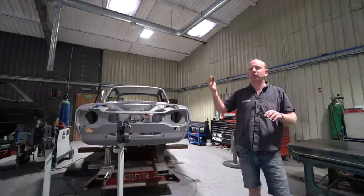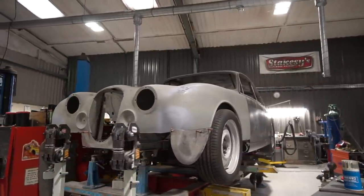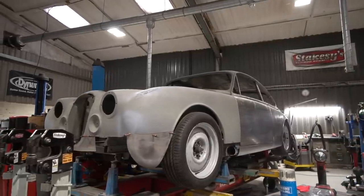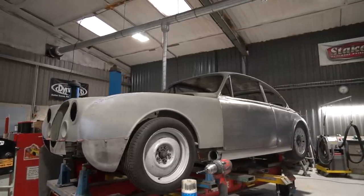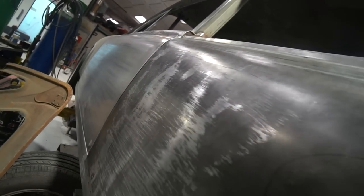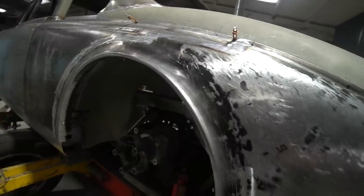When we want to make a panel for a car — say, picking a car that's in our workshop at the moment, we've named the project Churchill, the Mark II Jaguar two-door coupe that we're making — Stu's been making a lot of panels for that. The principle of shaping is that we need to generate a compound curve in a sheet of flat steel, to a particular shape that might be pleasing to the eye or conform to a particular design generated by a car designer.